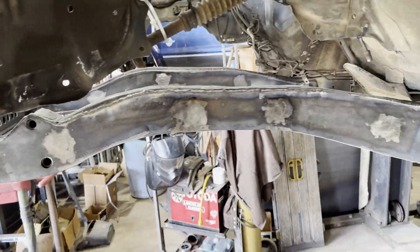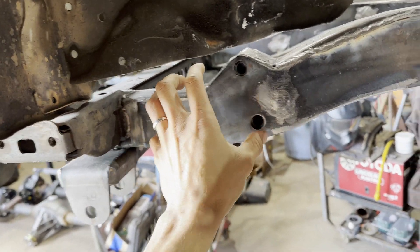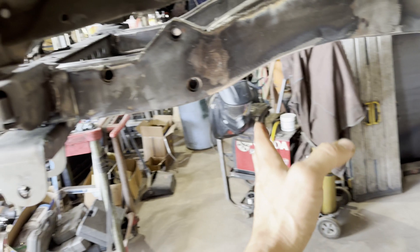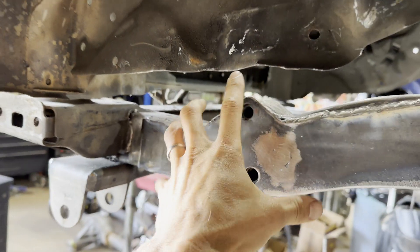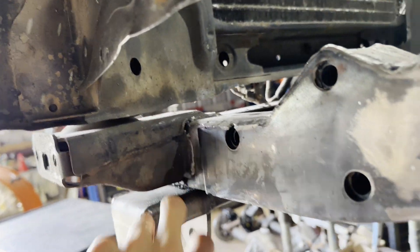Yeah, we got this nice bend going on right here too. Super stoked on the way this came out. We even turned the steering box so it turns more away from the lower bar — I'll show that more in some upcoming videos. We got the flat pitman arm on there so it's completely out of the way of the other high-steer bar, and you don't even have to cut your body mount or your radiator support. All my other trucks have had to do that when the steering box was turned like this, so this saves a lot of time.